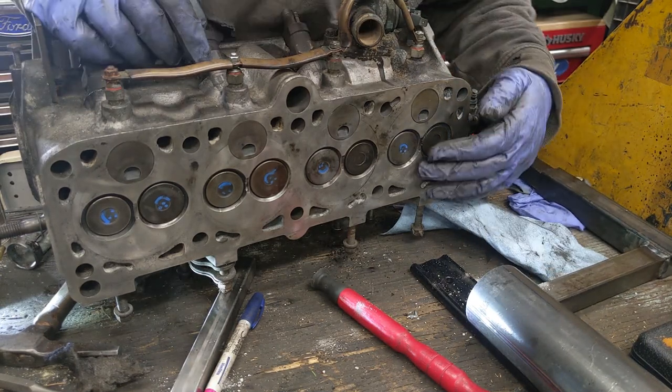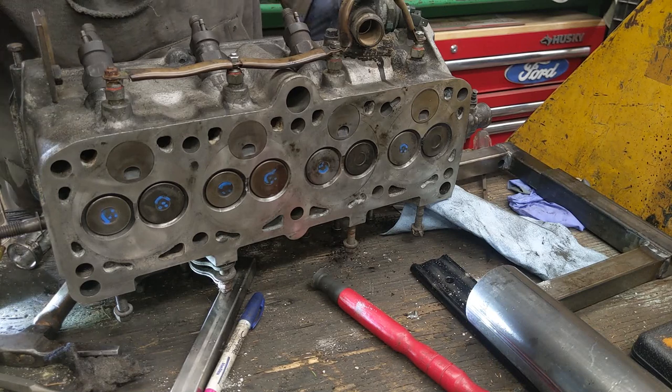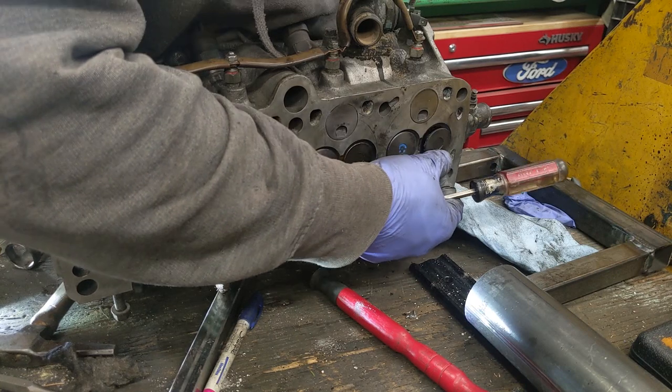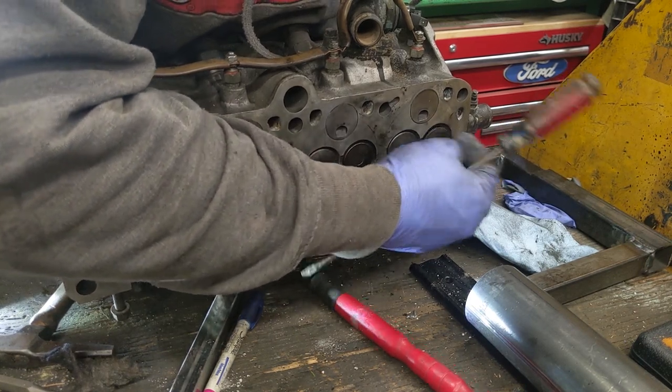If you really want to know how to unbend a valve, it's pretty basic. They actually bend pretty easy. They're actually pretty soft metal. Put a flashlight in there. Look through the different holes. See which way it's bent. Which side has, you know, rotate it, mark it.